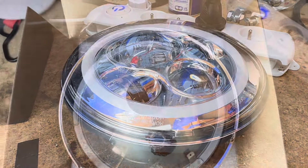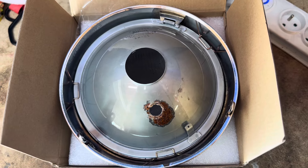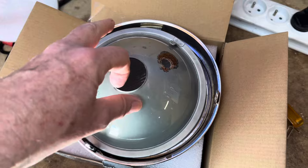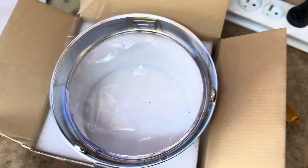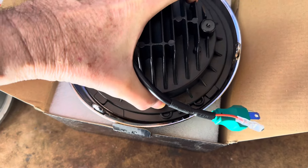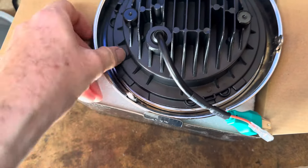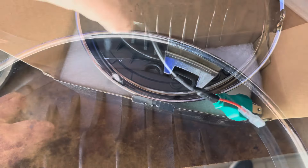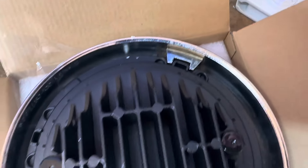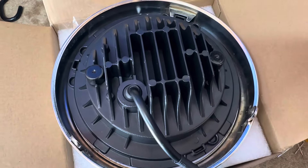That's what I'm going to hopefully fit. First things first, let's get the old reflector bowl out of the chrome bezel. Retaining springs are out. That's a good fit. There is a kind of a locator there, so I'm going to trust that that is in the centre. Put the springs in and see what it looks like the other side.